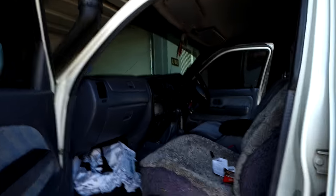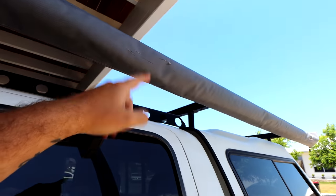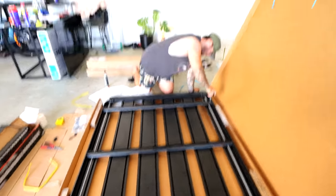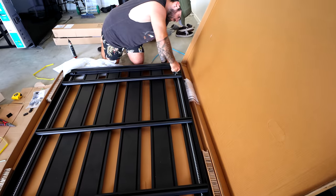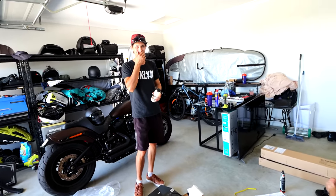All of the roof has been polished and it's looking mint. We've measured out the distance between the two holes front and back. Because Riley orientated the cutting on the sill trim bits more towards the back to meet up with the rear rails on the canopy, we're moving the little rails on the bottom of the Rhino rack further out. The rear will line up with the canopy rails, with a little overhang at the front up near the windscreen — leaving room for a sick light bar.